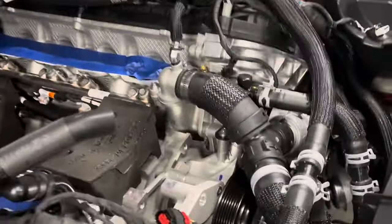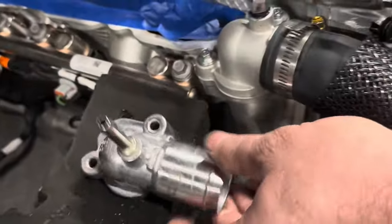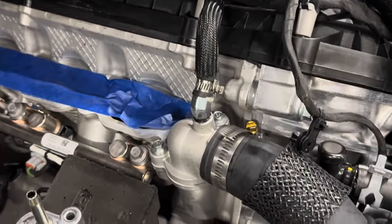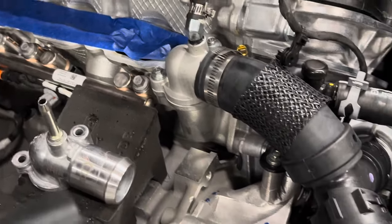This is one of your new fittings we just put in. The stock one basically gets in the way of the blower, so you get this new piece and they angle it off to the side. You're basically going to trim the hose down, put the new piece in, and then it gets everything out of the way.